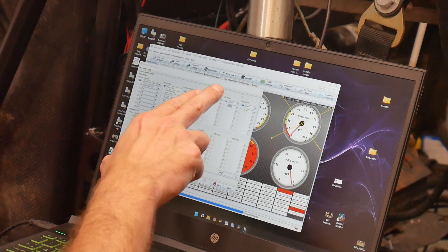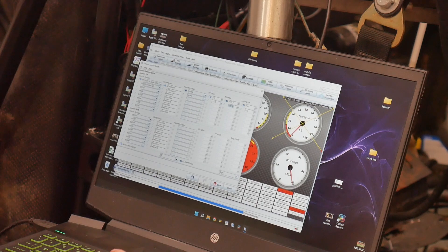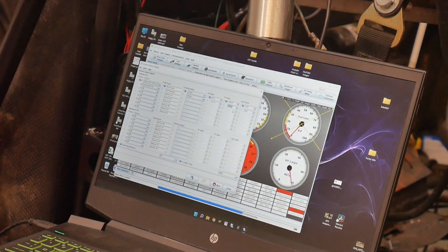So zero is zero — that's good. Now the five-volt value: if I change it to a hundred, that would mean all five volts are getting through there. But having a resistance value interrupt that five-volt reference signal, it's never going to be five volts. So as I lift the sensor — that is about half a tank of gas right there — it's only reading 20, and now I bring it all the way to the top and it's barely up to 50. Drop it back down and we're back down to zero. So that's not exactly what we want.